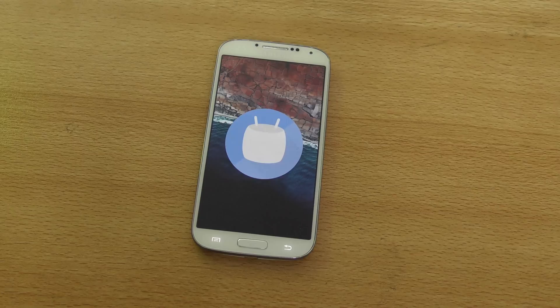And it's no joke — this is a custom ROM, not from Samsung. This is a custom ROM from a developer, and links will be in the description box. Make sure you download the ROM first and copy it to your internal memory — no SD card, just internal memory. If you are going to install this ROM, try it without the SD card, because the SD card can cause a boot loop. It's just a possibility — it might work with an SD card, but I don't have one in my S4.